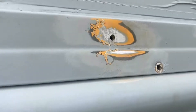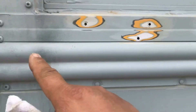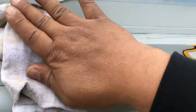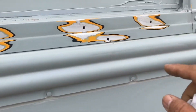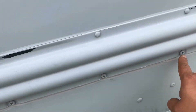My goal isn't to get down to the yellow or even bare aluminum — I just want to get rid of that surface layer. I had already sanded down that bar all the way but I was working around the screws because I didn't think I needed to, so that's why I've only addressed the screw areas. I'm just gonna wipe it down, dip my new screws, and put them in. I'll also caulk around that area and any areas I've missed. The rivets I can't get out, so I may just caulk around that little circle, but the other ones I'll take out and put new ones in.